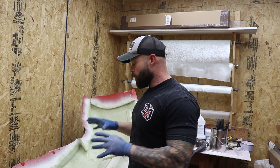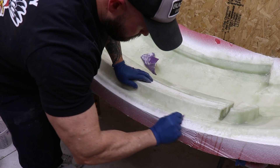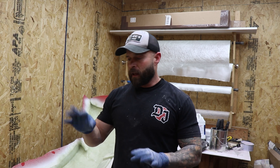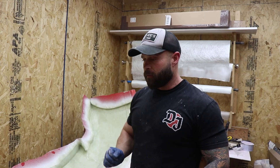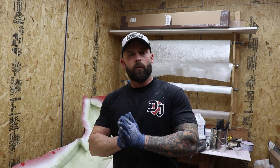Now that we've laid down most of our reinforcement for the bumper, we're going to sand along the edge of the mold where the two flanges meet up so we can get it all cleaned up and make sure it properly mounts. Then we're going to scuff it up and lay in our final reinforcement — we'll sand it, dust it, and then remount the mold.